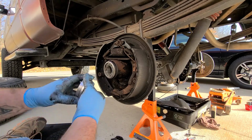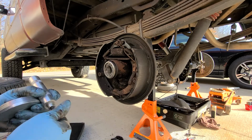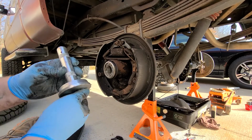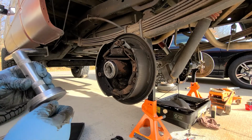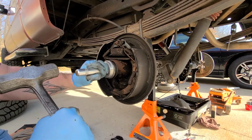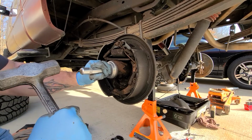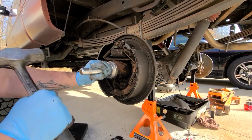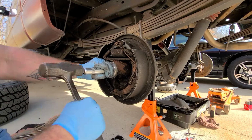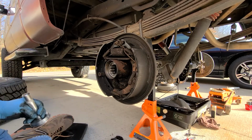So next, you gotta find a bearing pusher that fits on there. That was pretty good, the first one I picked out. So you put your bearing presser together. I have all these tools because I work at a garage, but you could probably rent them. Then you use your bearing pusher, and what you're listening for is, you know it's in when the sound changes. Hear that metally sound? It got deeper. That's in there.